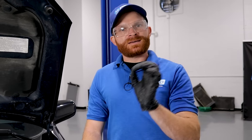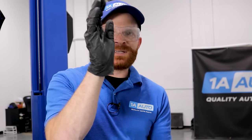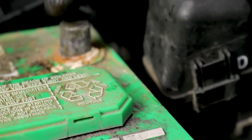With that said, we're going to release our negative battery terminal first, then take off the positive, then the bracket, and get the battery right out of the way. If you have access to one, you're going to want to use a battery memory saver. It's going to help save those radio stations for you, make sure the parameters inside your vehicle's computer aren't deleted, and you don't have to start over with your readiness monitors. It also acts as a surge protector for your vehicle's electrical system in case you take off that negative battery terminal and it bounces a couple of times.